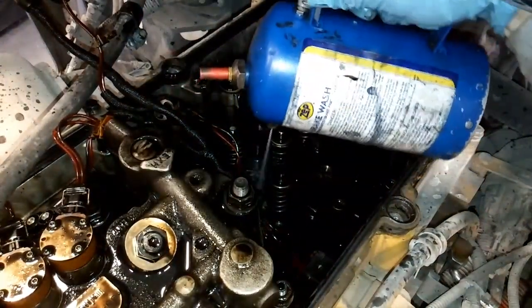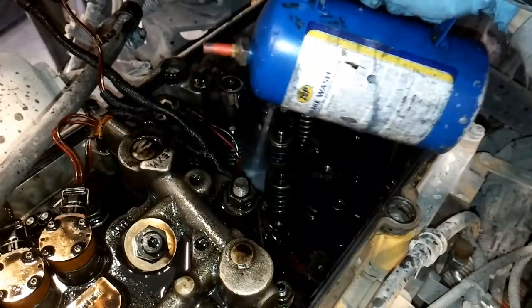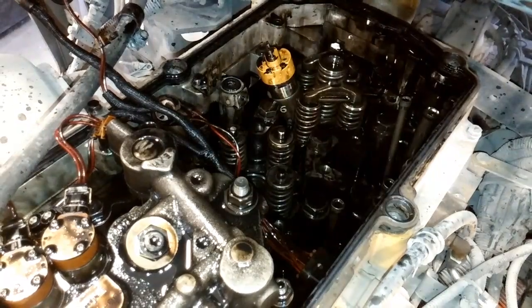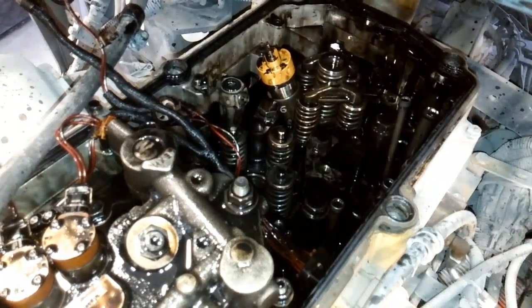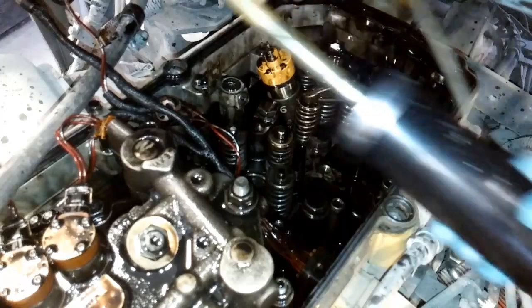So the injector is out. I'm now going to see if the cylinder will hold air. We're going to clean out the cylinder using a little bit of brake clean. This is also going to help push any carbon that builds up on the bottom of the injector bore, and that will help the rubber tip seal towards the bottom of the injector bore. Then you're going to evac that brake clean and fuel out.